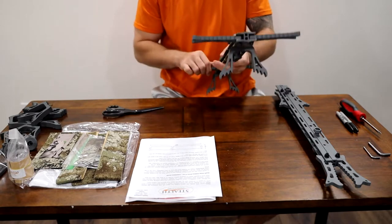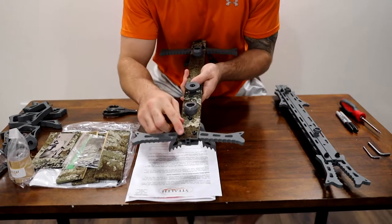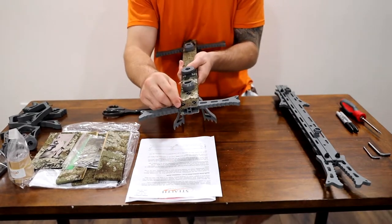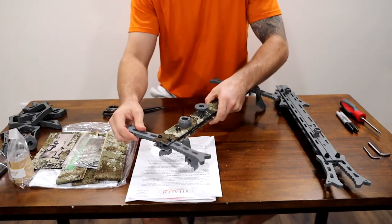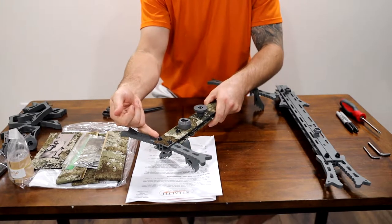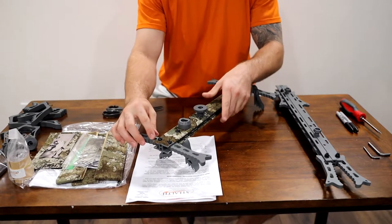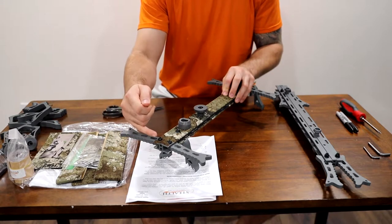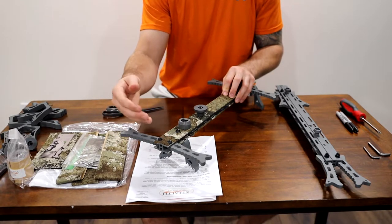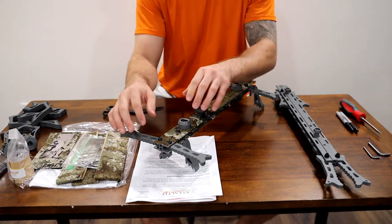But if you don't wanna watch the whole thing, the biggest thing that I would tell you is these screws here with the washer that go through and hold the steps in. They have another washer, two plastic ones on the inside along each part of the step. Now, if you do choose to take these off, I took the bolt out, I cut a square, which I'll be going over, took the step out, did the whole process, slid it back in.